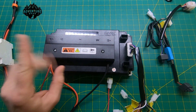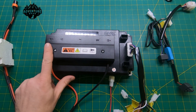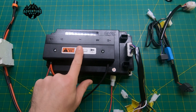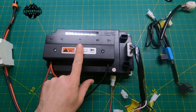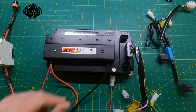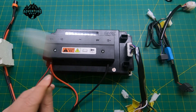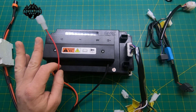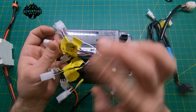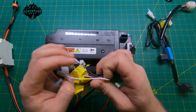There are five lugs under the cover: battery positive, U is the blue phase cable off the motor, V is the green, and W is yellow. Battery negative is also there. You'll need battery positive to power everything up and to power the display so it reads properly, but we'll cover that separately.